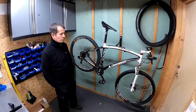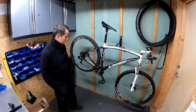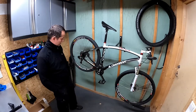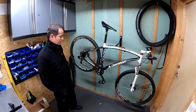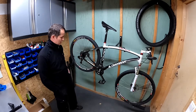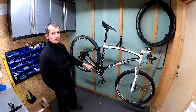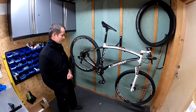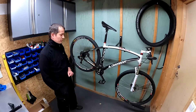This is a typical mountain bike with 29 inch wheels — a very nice one based on SRAM components. What is special about this bike is it has a press fit 30 bottom bracket, so I will have to install a special adapter.